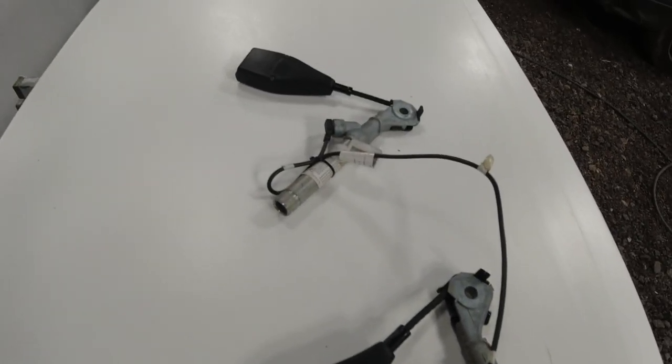There are two pretensioners on this one because it was a double seat. So that's how you take the seat out of a Renault Traffic and bypass the airbag light — they call it a diagnostic tool, which is what mechanics would tell you anyway. At least now when this van goes in with different seats and no airbag light, it'll pass an MOT on that basis. If you found this a little bit informative, entertaining, fun, or useful, please leave your comments below. Stay safe, stay well, and I'll see you next week.